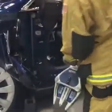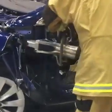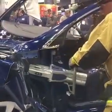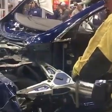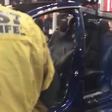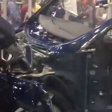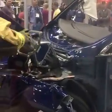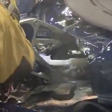It's so important with aluminum body structure vehicles — whether it's a Tesla or any of the many manufacturers now using aluminum structure — that we clear the material away and make appropriate release cuts so that when we do our dash lift, dash jacking, or dash displacement evolution, we get good movement. If we don't accomplish that, what can happen is that when we push on the lower A-pillar, rather than it gathering material and being pushed out of the way, it can actually break off, rendering our dash displacement ineffective.